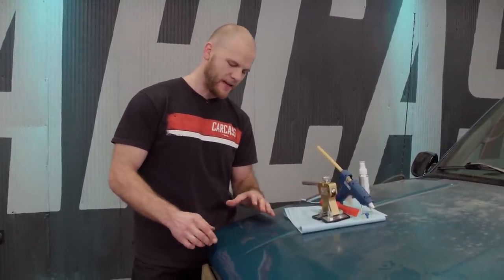I've got the majority of this dent pulled out, but I'm going to go back and do a little more massaging to get it looking a little bit better. The beauty of this system is that the paint in this area hasn't been disturbed at all — so once you get the desired result, there's no finishing work really to be done. On the other side of the hood, there are dents and creases with the paint already chipped off, so Jeremy's going to show you how to fix those using one more method.